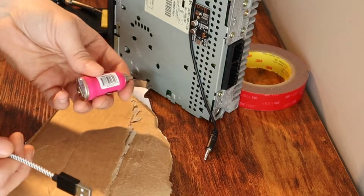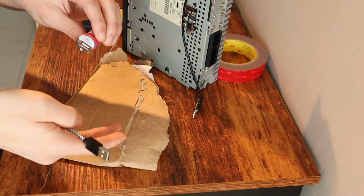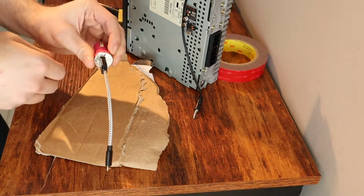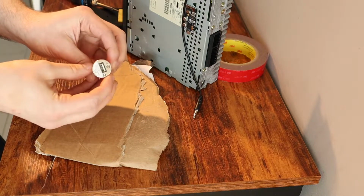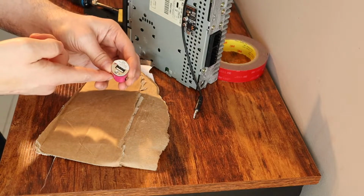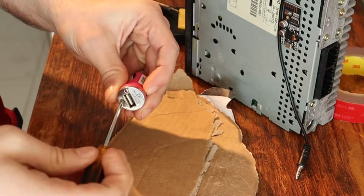So we will tap into power from that, but then what we're gonna do is take apart a simple little car charger like this, take our 12 volt power from the car, and put it into the chip that's in here, the little board. We'll plug this into here, like that, and then we can just plug this in there. I find it really easy to do on this style car charger specifically, and these are really cheap. This one actually happened to be in my Civic when I bought it, so that's just perfect. Whatever kind of USB car charger you're using, they'll all work, doesn't matter.